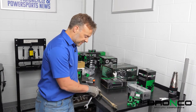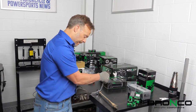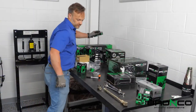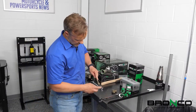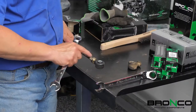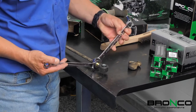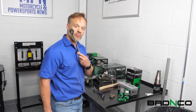Something you're going to want to look at with this: these threads — you're going to want to go counter-clockwise if you're facing the end of it, so that way you know you're loosening this up. So now if you look, there's my line, and I've got to make sure that this points even with my line — perpendicular with the line. We will make sure it stays there and tighten that jam nut. And now we've got the tie rod assembly ready to go back on the quad.